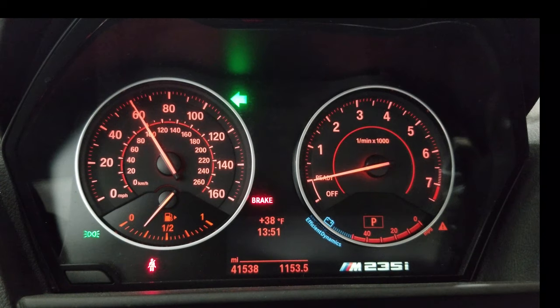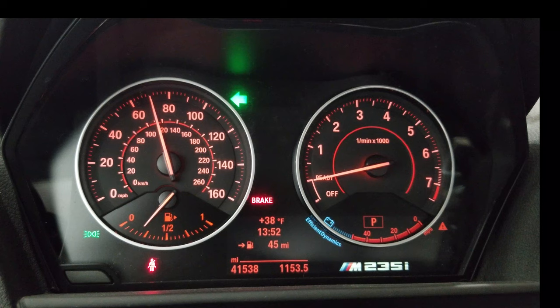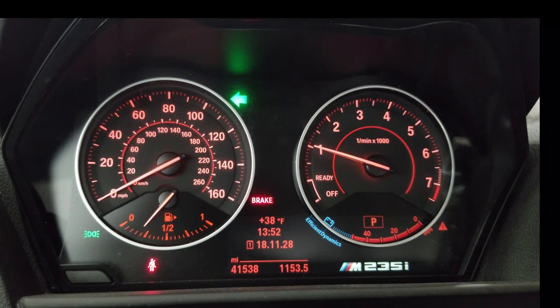The 60 tick is to limit boost in first gear — on or off, I have it off. And 70 is to limit boost in second gear — also off, as you can see on the tach. I might play around with limiting boost in first gear after drag racing a couple months ago I was having a hard time with some excess wheel spin in first gear. Even though I have an automatic, I was left-foot braking and revving up to about 2,000 RPMs at the launch. I might mess with that come next spring after this part of the country thaws.